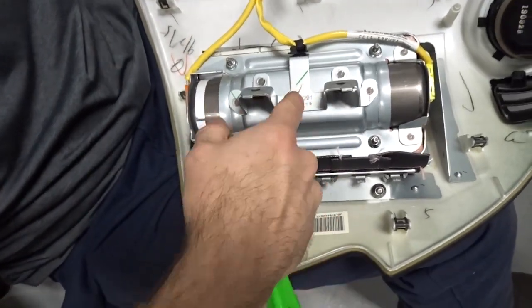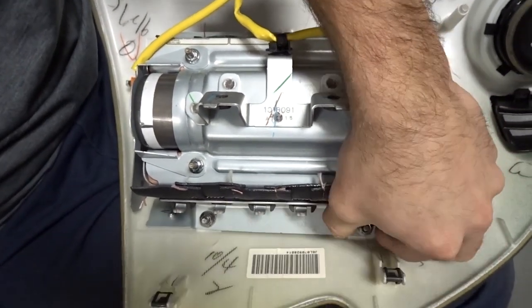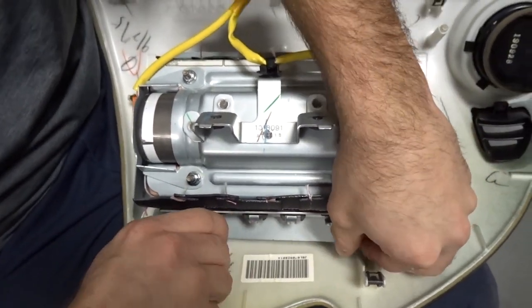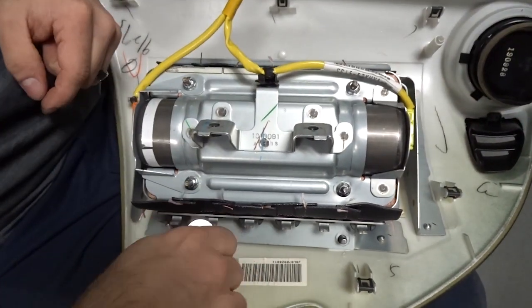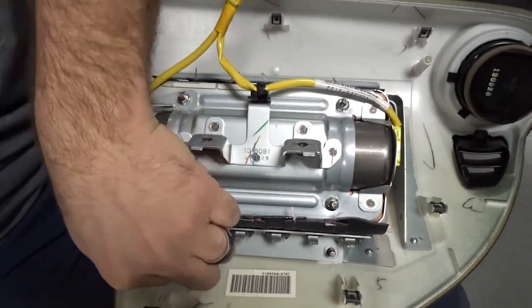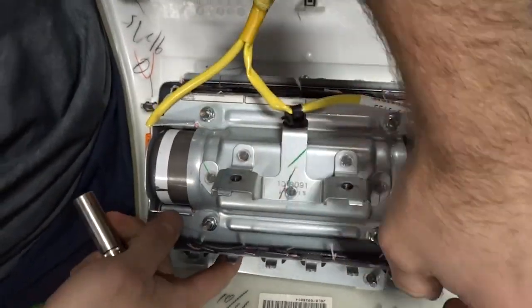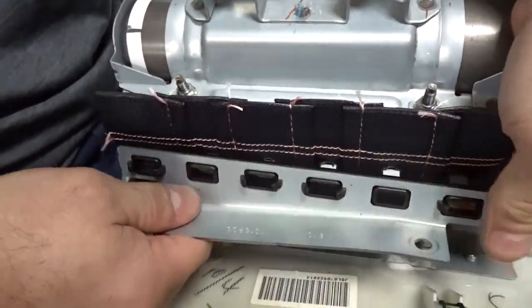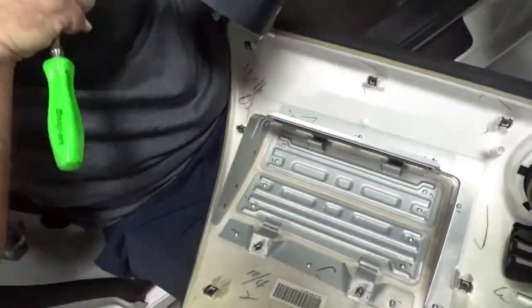This is how you're going to take the airbag out. Once you get it out, you'll want to flip it over and set it on something that's not going to scratch it — either your legs, a towel, something. Take these two 10mm nuts off, take this little metal bracket right here off, and then it kind of lifts up and pulls off. Same way on the back side — you just lift the whole airbag and it flips out, just like that.